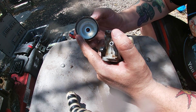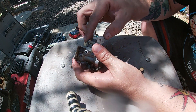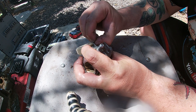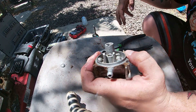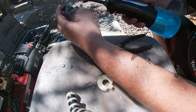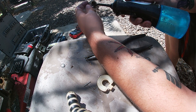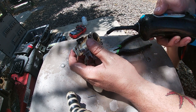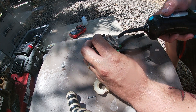We're going to pop that bowl open — the gasket is a little cracked, we're going to have to replace that, it's not a big deal. We can remove the needle and the jet, starting with taking out this pin here. You can see that high pressure is cleaning out some of these parts, making a big old mess though. Maybe this isn't the best way to do it, at least on this hot day it's not too bad. And you know what — this carburetor is going to run, I promise you that.